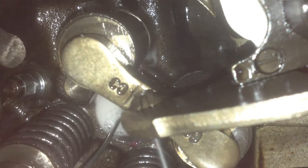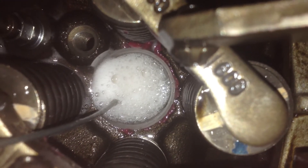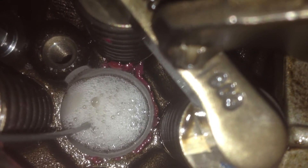Looks like we'll probably go ahead and throw an injector back in it. Look at it one more time. I don't see anything. Go ahead and fill it the rest of the way up with WD-40. Let the bubbles go down. See this leaking into the other bores — no, it's not going through the fuel passage.